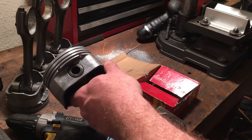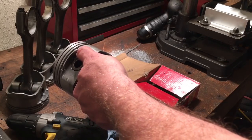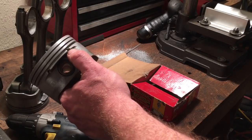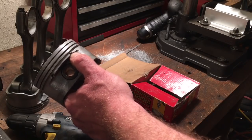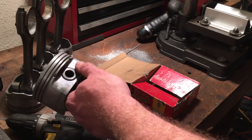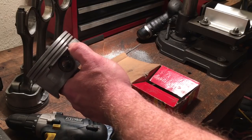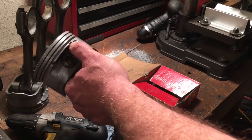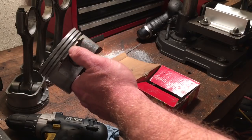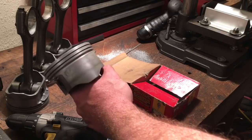One of the things that some of the engine builders and engineers pointed out was that when you have this small area for the drain from your oil control ring land, then you cover up a good proportion of it with your oil control support. Basically whenever the oil gets hot enough through the combustion process and the heat, it ends up getting gummy and thick and then it can't drain through these holes. So it ends up turning into a big huge mass and starts sticking and gumming up your piston rings.